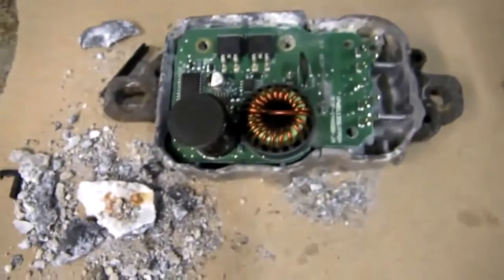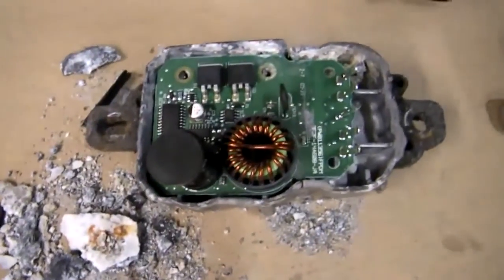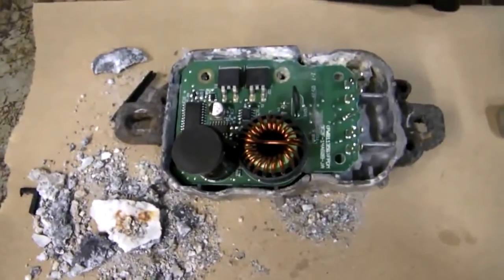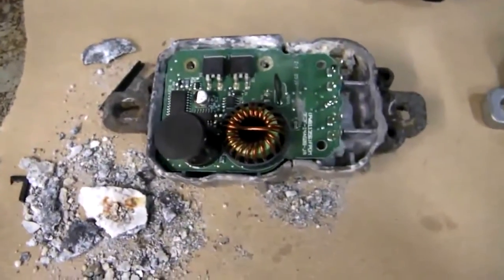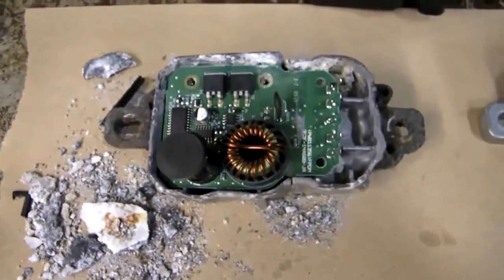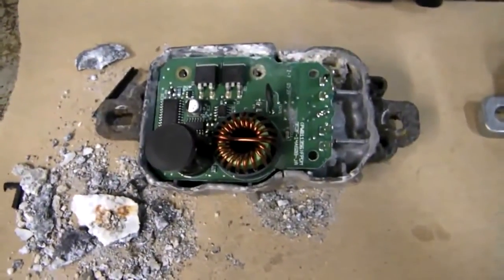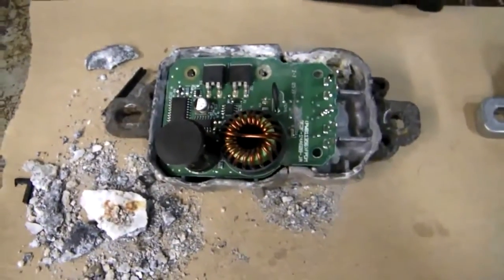A little salt back there — it's underneath the car, and within a few years you've got a lot of corrosion. A lot of people are misdiagnosing this; they're putting in fuel pumps instead of checking this. So if you do suspect your fuel pump is shot on your Ford truck because it won't start, it's stalling, it's acting funny, make sure they check this fuel pump module.